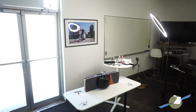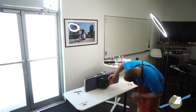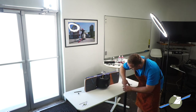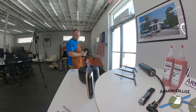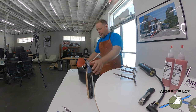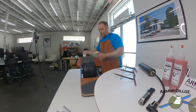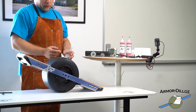All right, so we've got a little soapy water here. Nothing crazy, but as we see this, you can just see it blowing up these bubbles. Oh, let me go live on my phone to help out. Yeah, go ahead and get live on the phone. As a matter of fact, I'm going to set this upright again. We're down to 12 psi here, so we are going to have to add air. But again, we're just going to look at them bubbles grow.